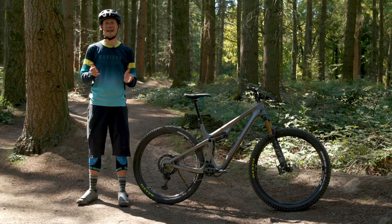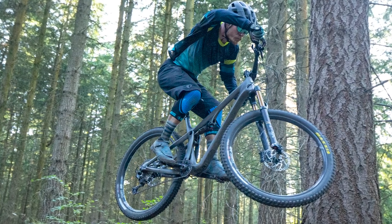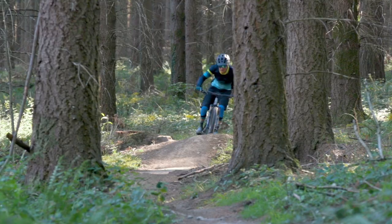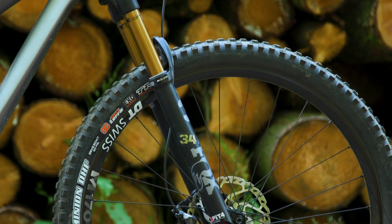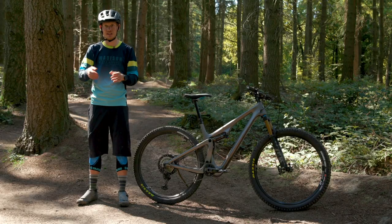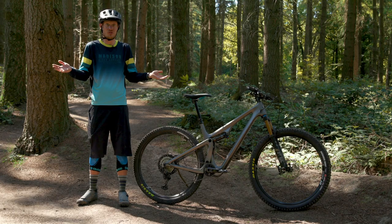On the steepest terrain you can notice the bike isn't hugely progressive. The 450mm reach on a size large is pretty short, even with the shorter offset giving extra stability — it's a short, nimble, agile bike rather than a big slugger. It does feel like an XC bike that's just been given a little bit of extra va-va-voom. I do think it would be better if it was slightly longer to give more stability, though that might encourage you to go a little bit harder than you should. Before the rear end gets out of its depth, you'll likely find the limits of the Fox 34 fork first — its narrower stanchions compared to a Pike, Lyric or Fox 36 mean it's more prone to flex.